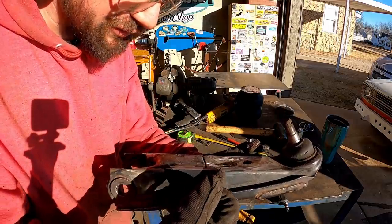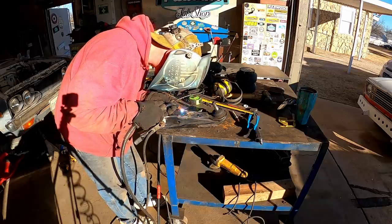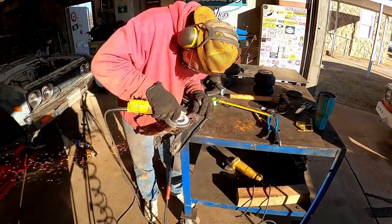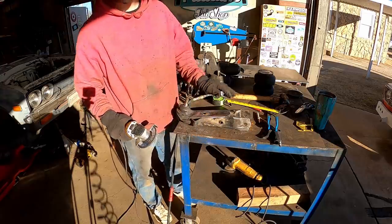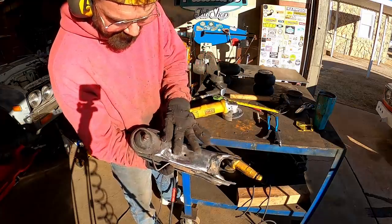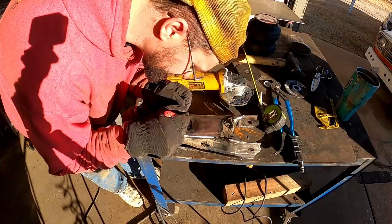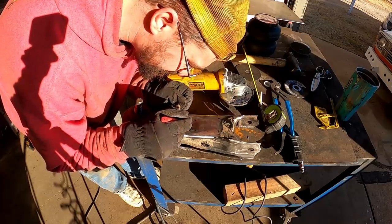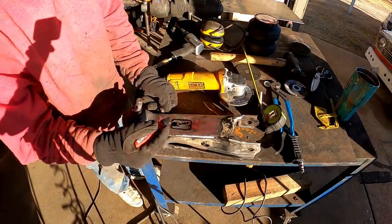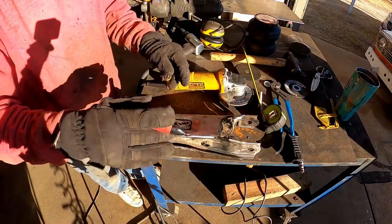Few smacks, she's laying pretty flat. We don't care about her being as pretty as possible down in there. She's gonna get covered up. But that's better than leaving all that baloney down in there anyhow. Because our airbag's gonna roughly fall centered in this area, we need that bolt access. I think I'm just gonna cut us out kind of a rectangle roughly there.